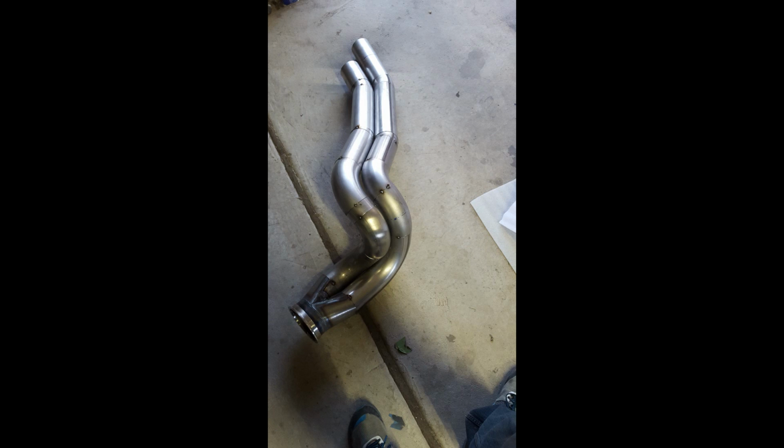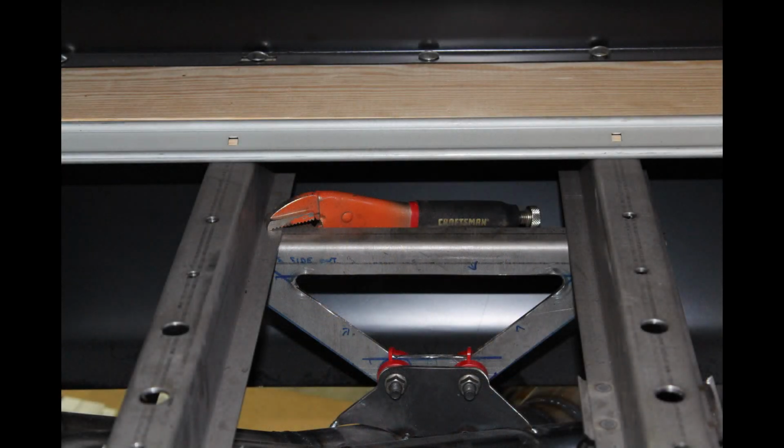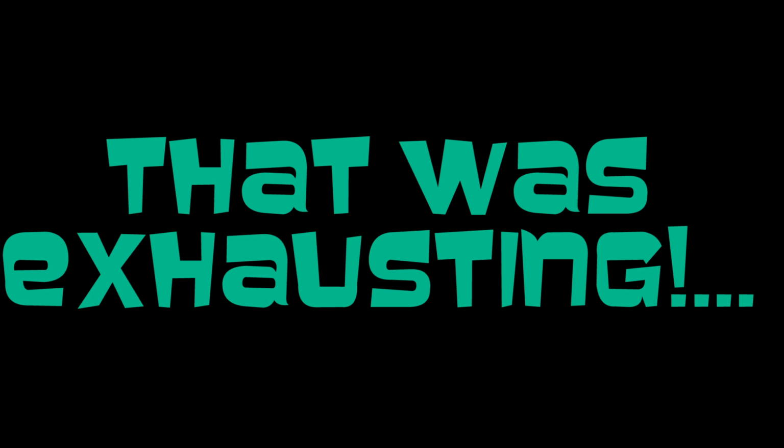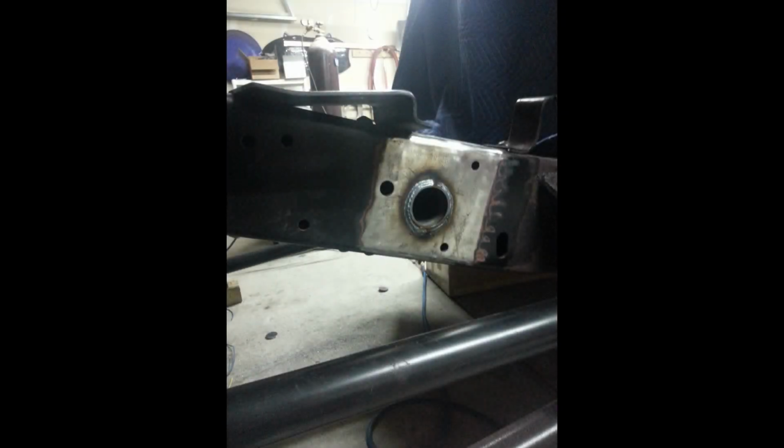Used snapper grommets and made those tabs to mount the pipe to the frame, and then also used the same thing to mount the tailpipe to the bed structure, so it has a little wiggle room, but it is pretty hard mounted. Some funny pun words, because puns are funny, right?